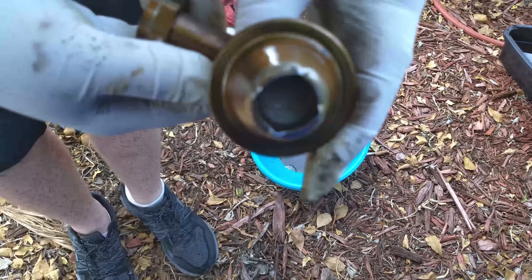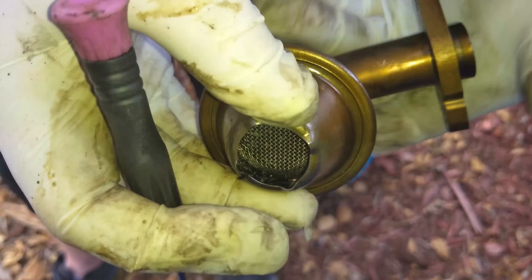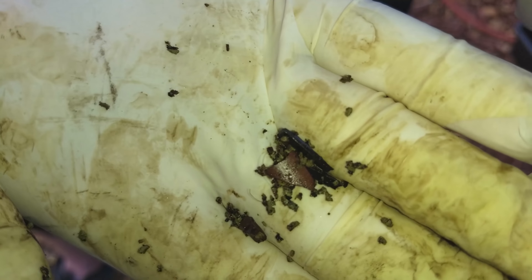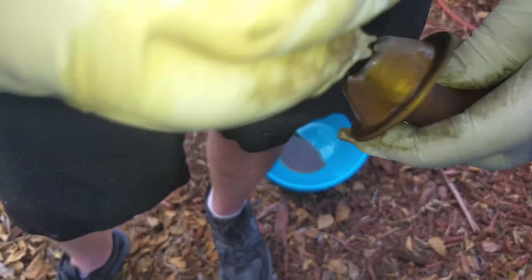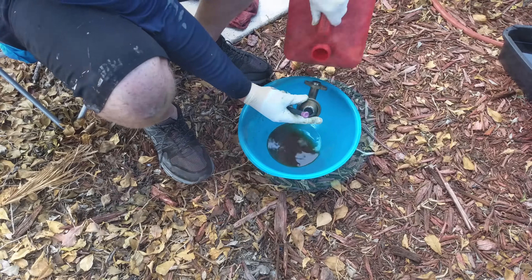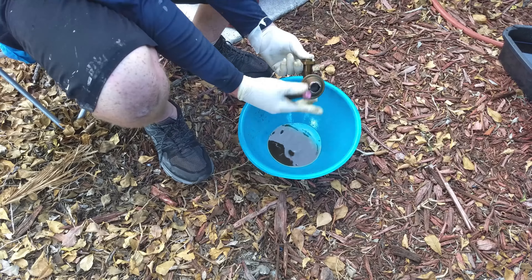It came out pretty clean, but on closer inspection it had all this debris on the inside. I took a small flathead screwdriver and went around the inside to get all the debris out. Some of it was plastic from a guide — the cam chain guide is brown on top — and the rest was dirt and whatever had gotten into the engine. This pickup was doing its job but got clogged and needed cleaning. After getting the debris out with the screwdriver, I came back with more gasoline and shook it really well. Gasoline works great at breaking this stuff up and I got it cleaned up pretty well — no need to buy a new one.